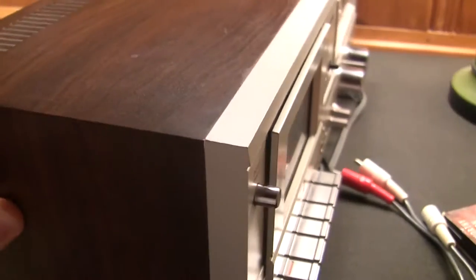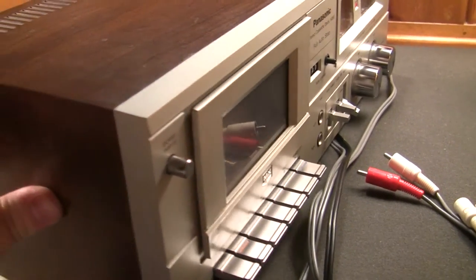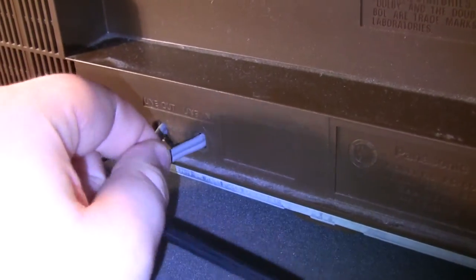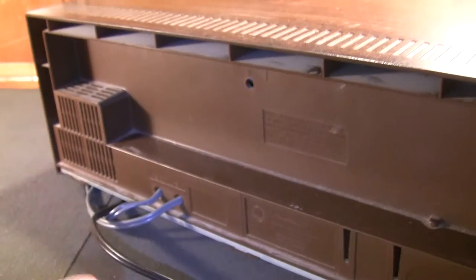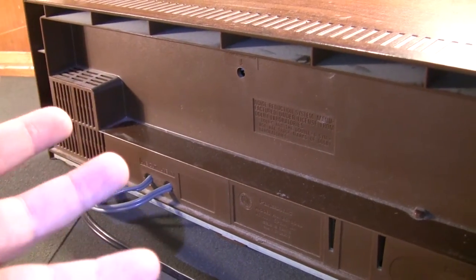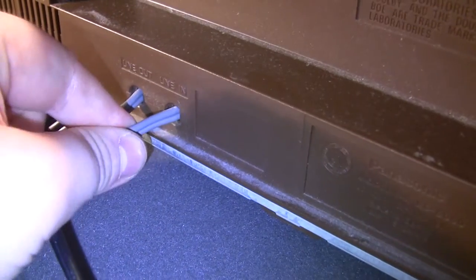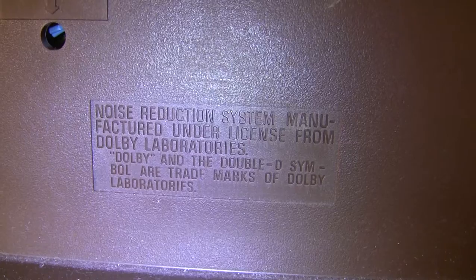That was one of the reasons I bought this cassette deck — I was quite keen on the design. It matches pretty much any component you put it next to, aside from the dust. Back here it's impeccable: you've got the power transformer with adequate venting and your line-in and line-out jacks, which are permanently mounted. That presents something of a challenge for buyers, as I came across an alarming number of these Panasonic and Technics decks with the permanently mounted RCA cables cut or damaged.